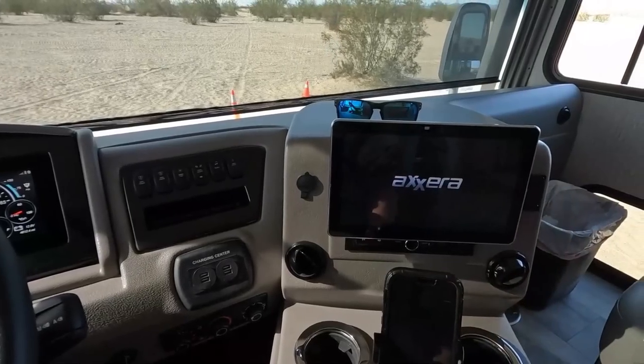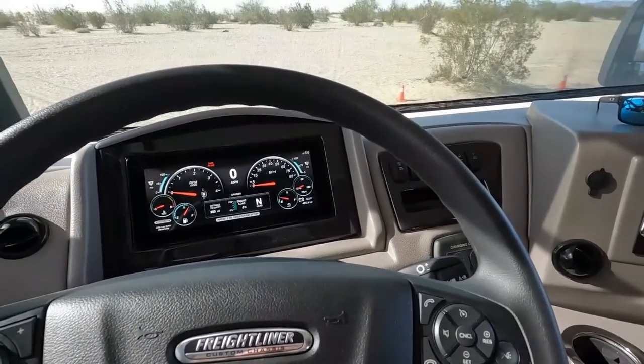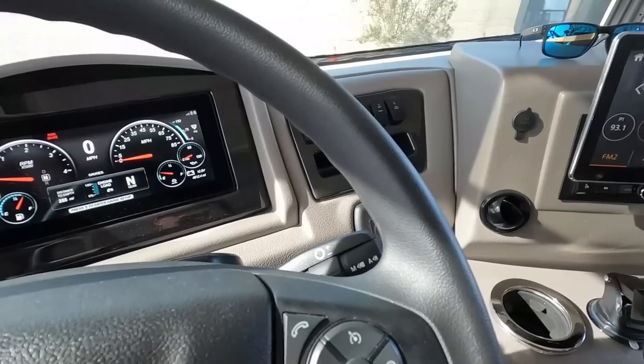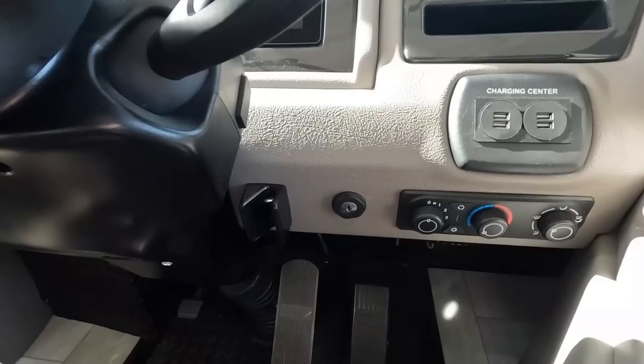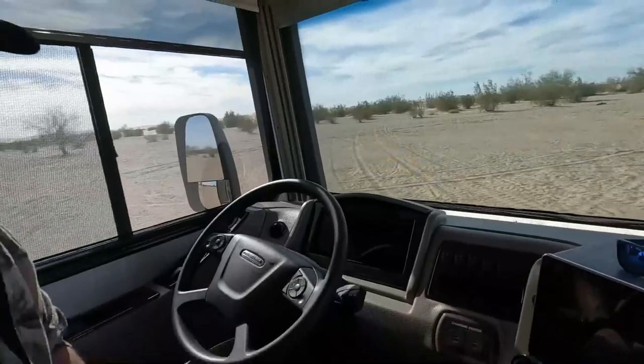There's kind of an iPad setup to control everything inside — radio, all your hookups. Everything runs up here. They've got a big charging station. I like that everything's digital, modern. Here is the airbag dump — a cool feature of air suspension. When you get to camp or when you store it, you flip the switch and it dumps all the air out of the airbags and lowers the coach — I believe they said four inches. But when the airbags are full, this thing has an absolute ton of ground clearance. A big plus for us who go off-road. You dump the bags when you get to camp, drop the coach close to the ground, then drop your levelers.